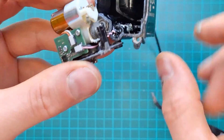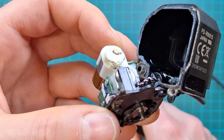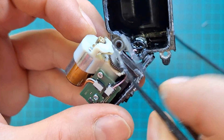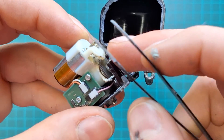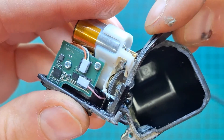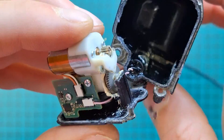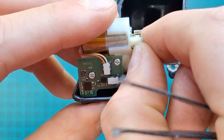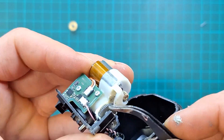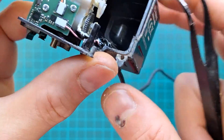I'm going to clean it nicely and improve on Shimano's design by melting a little bit of plastic on top here. That's going to prevent the pin from going further and also fill that gap. When it's put together, there'll be no movement and that pin won't come out anymore.